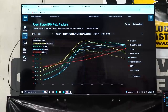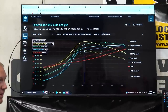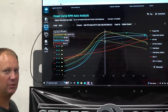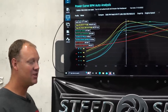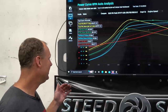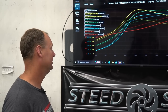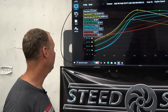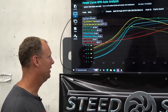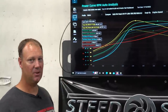We were a little bit smokier on the full power run with the new injectors, but they're moving more fuel while burning it a lot more efficiently. For our stage-one injector, these are too big — we're going to get a smaller set. We're kind of giving you guys a glimpse into the R&D phase. These are not available to purchase as of yet. This is probably going to be our second level. Over 100 horsepower increase over the 5x11s with less heat and more boost. It's amazing.